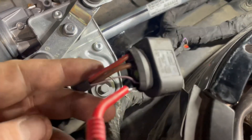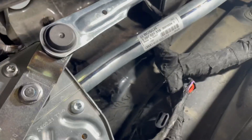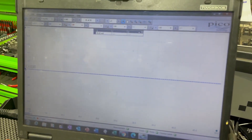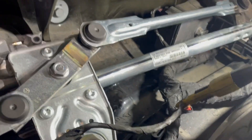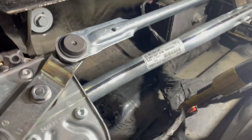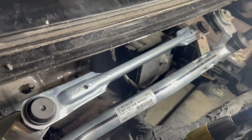The easiest way to find a break in a circuit is to try and split the circuit in half. This is the wiring that comes out of the main harness going to the wiper motor. I've stripped a bit of insulation off and exposed that wire. What I'm going to do is side-probe that wire - a little tiny pin prick in the wire, wind that on, it pushes the pin into the wire. Take a look at the scope - no signal. That's telling me the fault, the break in the wire, is in that direction towards the main wiring harness, which runs under the engine ECU.